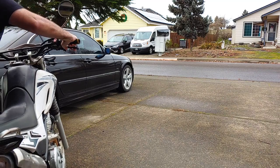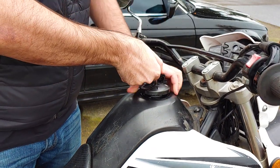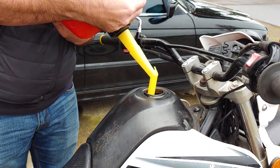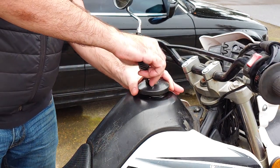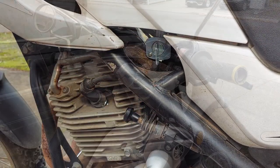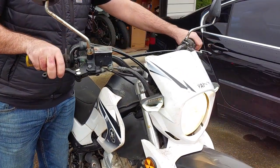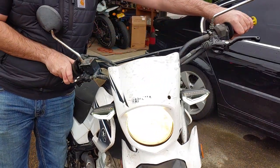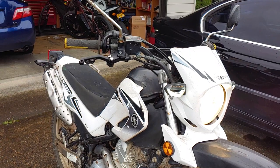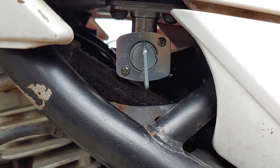The last thing to do is start the bike up and make sure it's working properly. This bike doesn't have any gas in it because it all leaked out when the petcock went bad, so make sure to subscribe so you don't miss my upcoming petcock replacement video. With the engine warmed up, turn the bars all the way to one side and then the other, making sure that the idle speed doesn't change due to tension in the cables. Test the throttle for smooth operation and double check that the free play is set properly. It looks like I'll be replacing that fuel line before this bike can be ridden again, so look for that video coming soon.